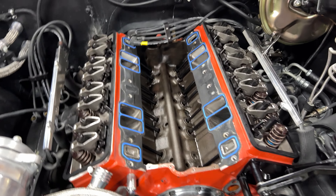I think in one of my recent videos from Pigeon Forge, I mentioned the engine wasn't running quite right while we were up there. We thought maybe it was just the camshaft not being the right one. But it turns out it probably wasn't running right because that push rod was broken. With that cylinder being off, that would cause it to misfire because it's not getting what it needs to combust or exhaust properly. If we hadn't found that, we could have probably just ended up running this engine until something major happened and cost a lot more money to get fixed. So we're glad we actually ended up doing this.